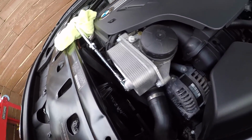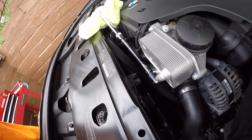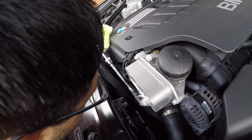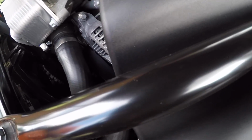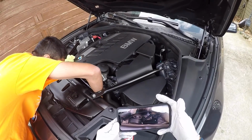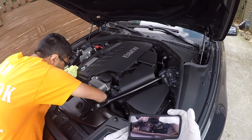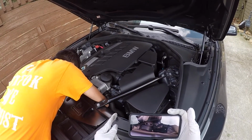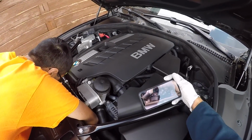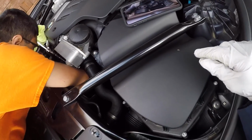Alright, it comes up directly from the bottom to the alternator, that's right. And then it crosses over to the AC, so it doesn't go under that, it goes to the AC next. Then it goes over, around the AC and back, okay, here. So this one actually goes here. Oh, from the AC over the crank, and then to the tensioner, and then to the AC. Yeah. Always good to take a picture of it before you take it apart, I guess.